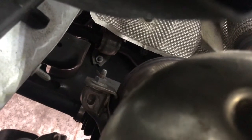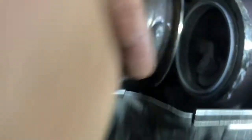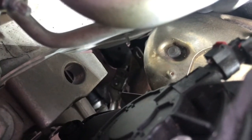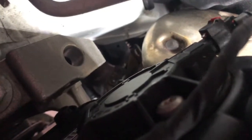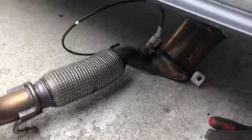The one from the other side is easily taken out from under. I'm going to move the downpipe out of the way — you can see where the other bracket was. That little bracket right there is two 13mm bolts. Get those out and now you just have to pull the downpipe out. The hardest part of this whole thing is taking out the old downpipe.